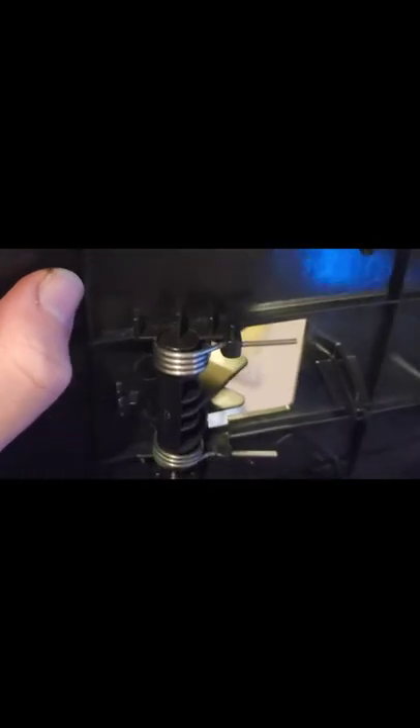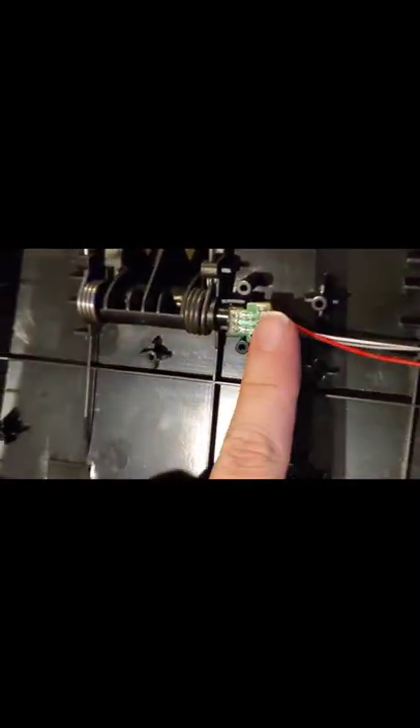You just want to make sure that while you're pressing that pedal, the entire rotation, it sits down in that seat — like it does on the other side. You can do what I'm doing and try to stop it from moving by gluing it. Hot glue is probably best; I'm just going to use super glue. Another thing I could see causing that issue is dust getting in that track. I'm going to put a little dab of silicone grease in every little seat where that dowel sits. I'll take each pedal back out and put silicone grease in every U that those sit in, and also on the coil of the spring — because binding and friction of the spring coils on themselves will give a weird feeling and a lot of inconsistency. Hopefully this will help bring a lot more consistency to your pedals.